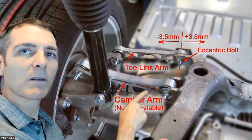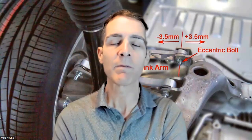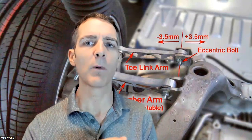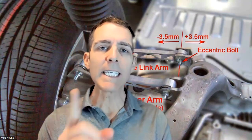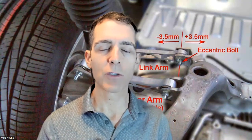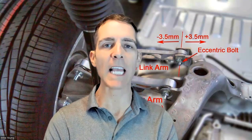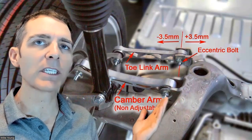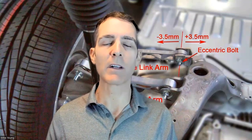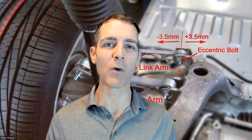Over the last few years, Tesla has come out with several revisions on the front drive axle and CV joints — they've gotten better and better. The ones currently on my car have been on for about two years and are doing fine. For Model 3 and Y with fixed suspension, you're probably fine — no problem at all. You might have a problem with the front axle if you're an aggressive driver who floors it while turning, which can destroy CV joints on any car. But on Model S and X, especially X, there's a special set of circumstances.